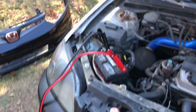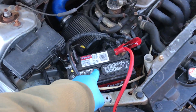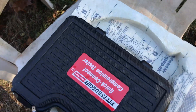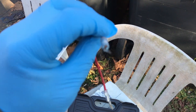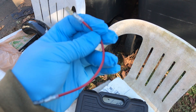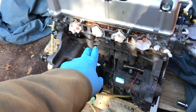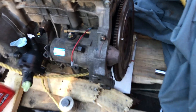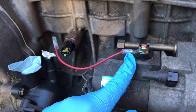For the information I gathered on what you need to do a compression test on an engine outside of a vehicle: you're going to need a battery, jumper cables — positive and negative — your compression test kit, this is a Harbor Freight one, and an insulated copper jumper wire for the positive. Obviously we have our original starter and a flywheel. This is a K24 block with a K20 flywheel, so this starter should engage this flywheel — hopefully.